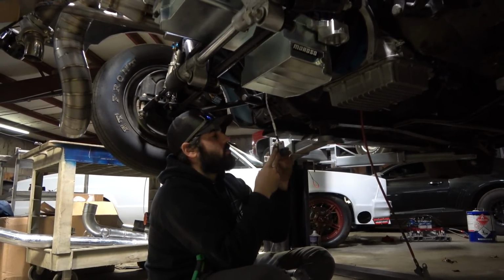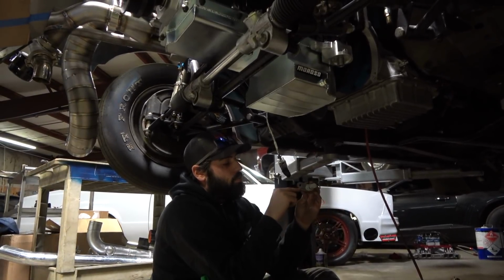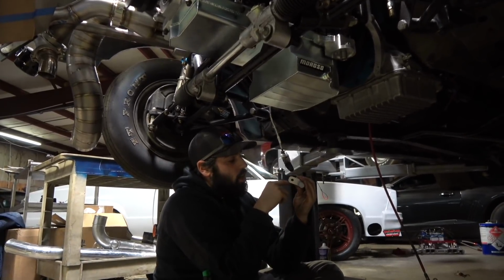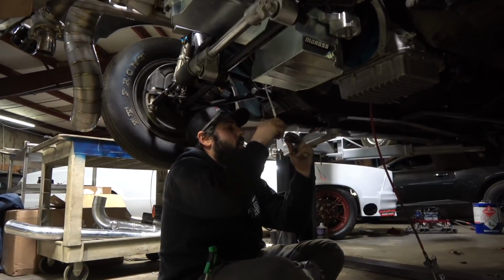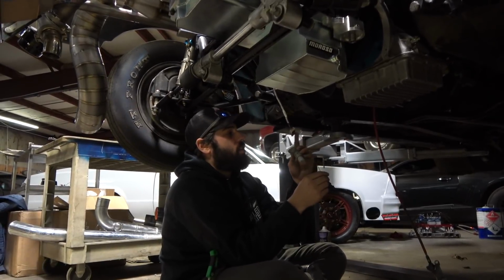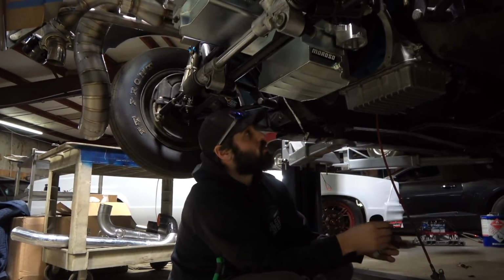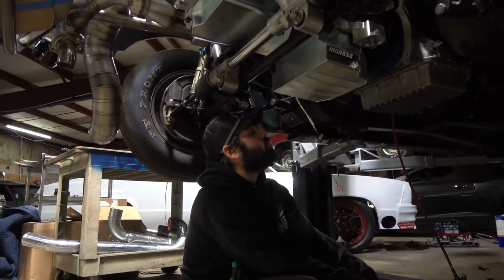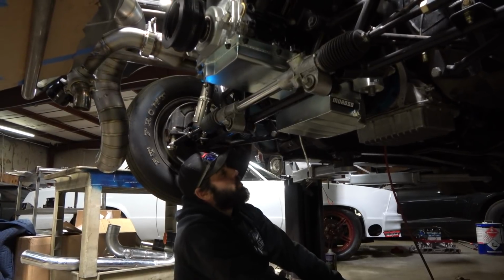So I need to get a different connector. Isn't it just the wire? I think 2 wires are flipped or something. Yeah, but it's got a plastic piece that's in the way. They either have it on the top or the bottom, and on the 58 tooth it's on the bottom, on the 24 tooth it's on the top. So if this connector is specific like it is, it won't plug in. I took the starter down because I was like, why won't it plug in? Couldn't figure it out. Well, there's the reason why. I mean, you could probably just knock it down. It's not that large. Well, we got the harness mostly plugged up.